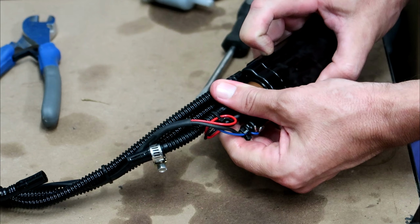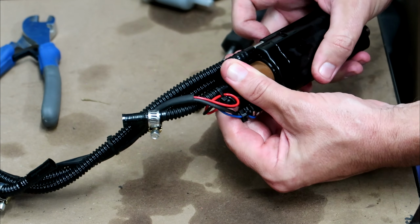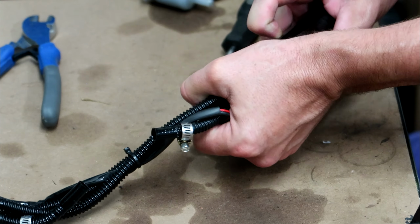So I actually decided to cut the filter open and just have a look inside, and you can see how dirty it actually is in there. A lot of that crap there is from where I hacksawed the top off of it, but you can still see just how dirty it is inside there. Now there's a screen inside the pump as well. If you bought the filter kit from KTM, you'll have a replacement screen. I don't find that the screen seems to wear out at all, so I just give mine a quick clean and then put it back in.